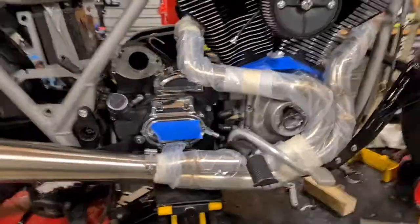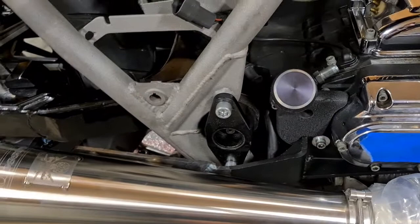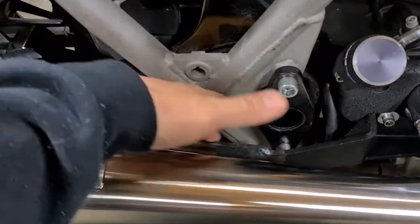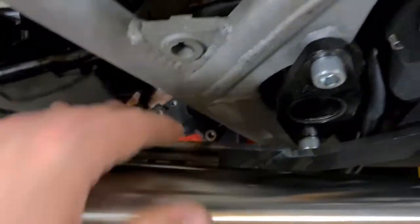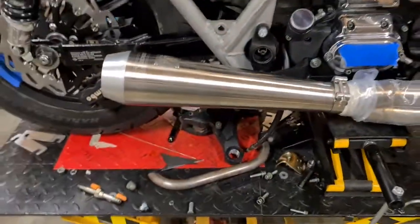Super nice pipe — I love any pipe that goes around the front cam chest. I know you give up a little ground clearance but whatever. Being a Dyna pipe, the primary is about an inch and a half longer, which means to put it on an FXR you need to extend the mount. I just chop it off on an angle and make a new remount. I bolt the pipe up, get everything tight, and then see where it naturally sits — I don't like welding a mount just for the sake of it and then having to bend the pipe to fit. This one wanted to be welded on a slight angle so that's what we did. There's a little bit of clearance at the pivot blocks but we should be good.